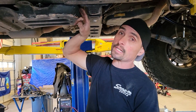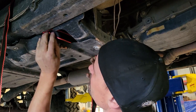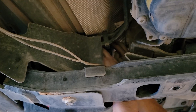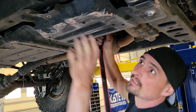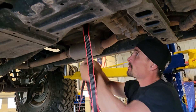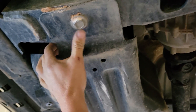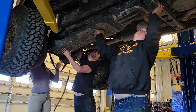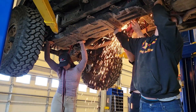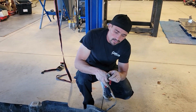What we got to do is strap the gas tank without strapping the old skid. You can get around it in the front — you have to go over the frame, then floss it under the front of the tank and up and around. Grab the skid plate and go up over the trans, holding the end of the tank up. Now we should be able to take the bolt off. I also suggest cutting the T-strap tab so you can break it off with pliers.